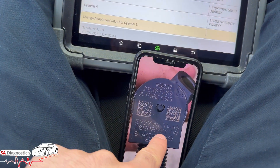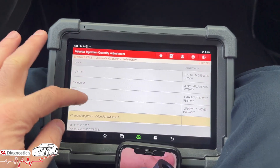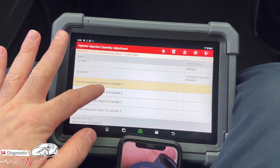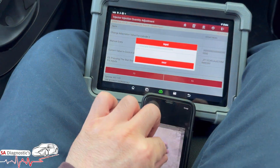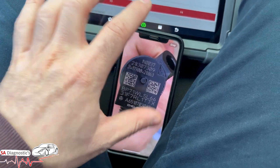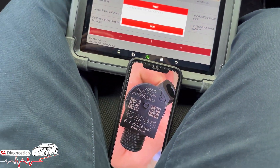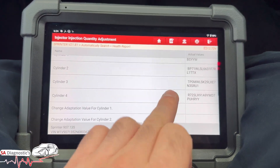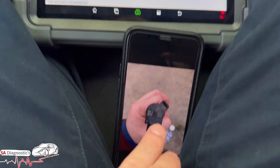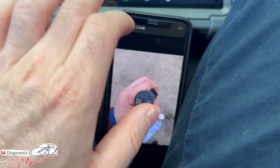As we can see, BSYYW and BSYYW — so it's overridden, which is good. That's cylinder one done. We're going to cylinder two — press F4 and do the same for every single one. If you mess up any of the digits it will not work, it'll just kick you back out — it'll just fail. So make sure you input the right thing. The last one, cylinder four, is RYYR YY.